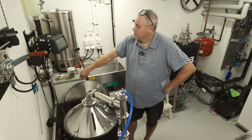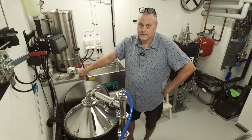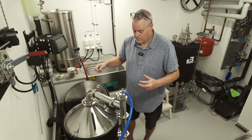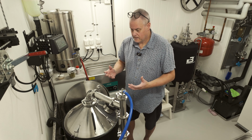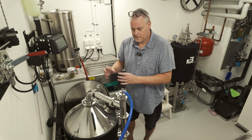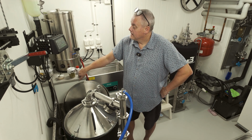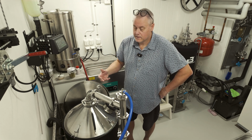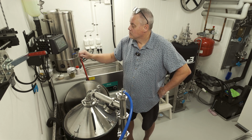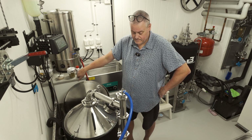I'm still running the pump at 100%. When you start coming up to 98, 99, you will hear the pump start cavitating because it will start to be air trapped inside, boiling water. And then you can still run the pump. Once you get up to a boil, you don't need to run the pump. But you should then lower it a little bit so you don't run on 100%.